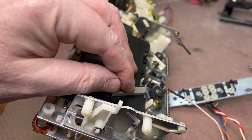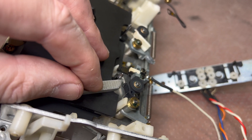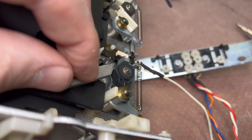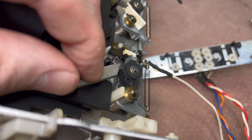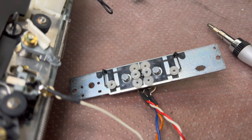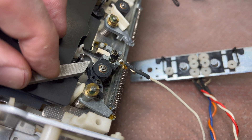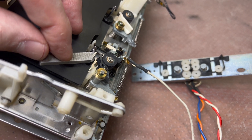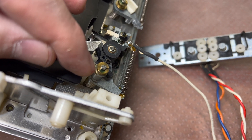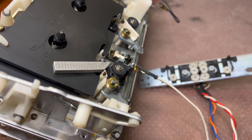When I received this 482, I saw that the head had been screwed. I fixed the record and playback head, but I was not able to make the erase head fully rise - now you may see the reason. As you may see right here, it sits too high. The guide needs to sit lower, and that's where the tape doesn't go through the middle of the erase head. I've already soldered the playback head, so now we will adjust this before assembling, just to not have to return to it again. Lucky that I just remembered it. As you see, these pins just hold the arm on the shaft, so I will have to pull them a little bit lower.